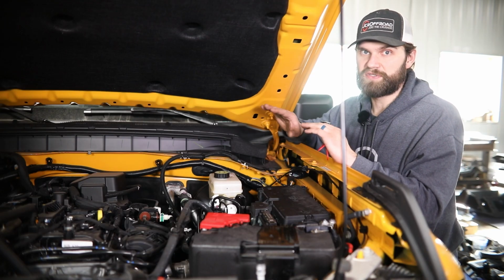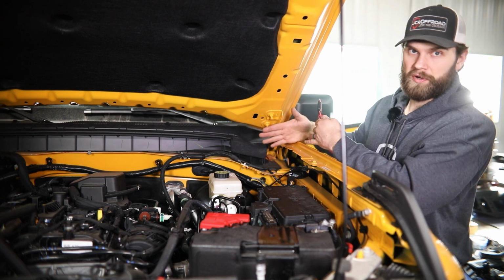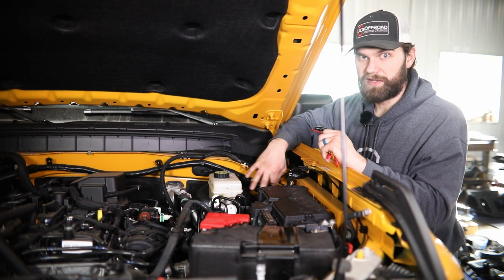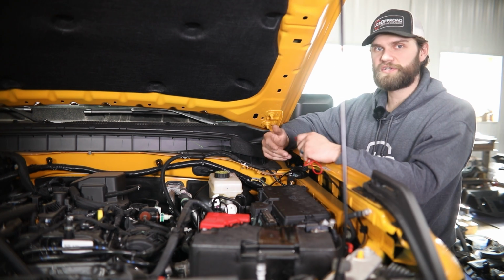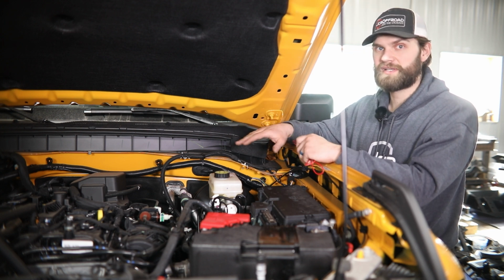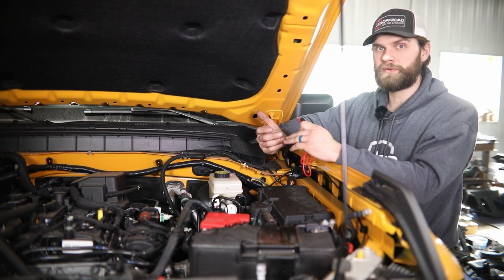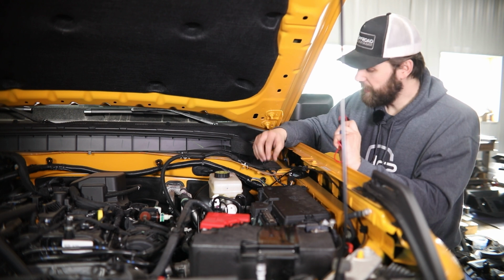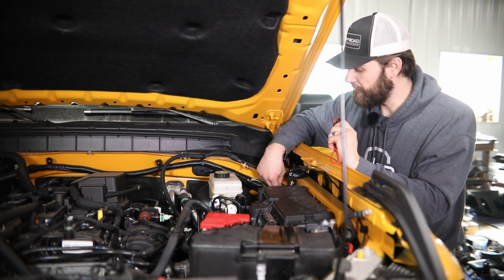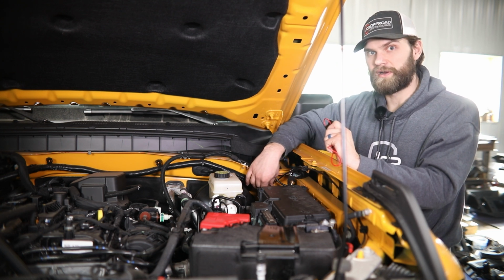So the other end of those wires you tied into under the dash is going to pop out right here in this rear corner by the firewall on the driver's side. So you just need to come up here, find the wire you're tied into. So if you're choosing to wire these USB ports into one of those factory auxiliary switches, you're going to need to look up the wiring color coding for those in your owner's manual or on your factory touchscreen display, and then just tie the brown and white wire, for example, that we're using in to the appropriate color over on the other side right here for that switch wiring harness.